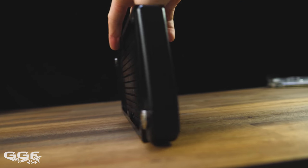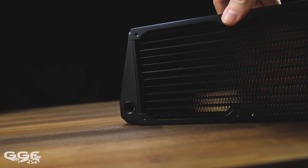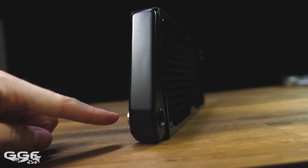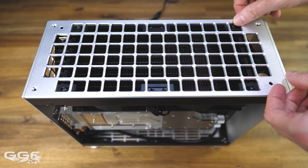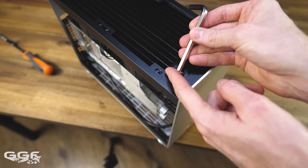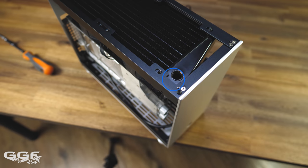Also in regards to this radiator, there are four G1/4 ports - one set in the opposing corner, but they are on each side of the radiator. This meant I could fill the system straight from the top; unscrew the chassis cover panel and I had direct access to two fill ports, although some light filing was required.